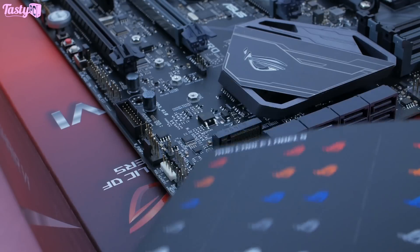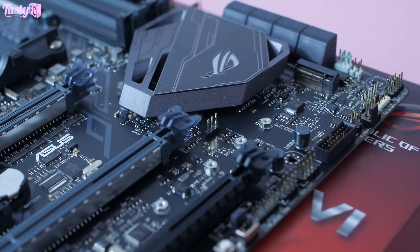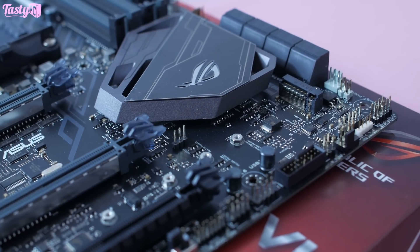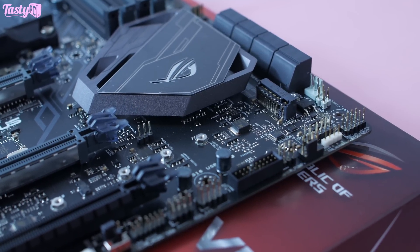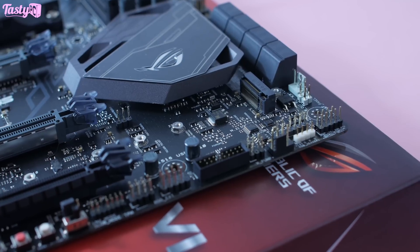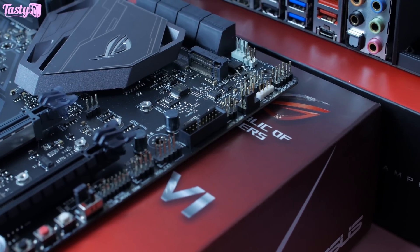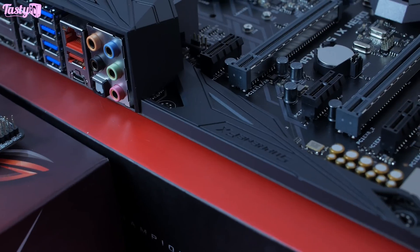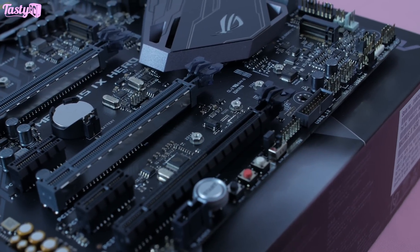There are also eight SATA 6Gb/s ports provided by the X370 chipset. With the board you get four black SATA cables and some cable stickers. I would really like to have seen a second M.2 socket — firstly, I've been hoping to move to a completely cable-less storage setup, and I'm more likely to find myself with a single low-capacity M.2 drive to begin with and then eventually get a second for additional capacity. The Z270 Hero has two M.2 sockets, and so do a lot of other X370 boards currently on the market, although it is worth paying attention to what speed the additional socket runs at on those boards, as they're usually not PCIe 3.0 x4 speed. I would have personally preferred a second M.2 socket even if it was slower, but you could always use a PCIe slot adapter if you really needed somewhere for a second drive.